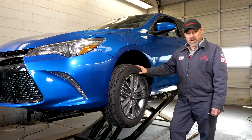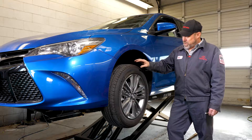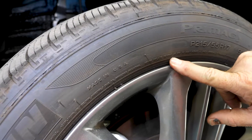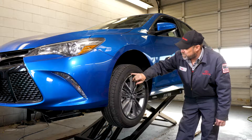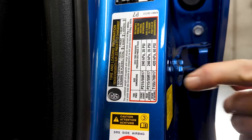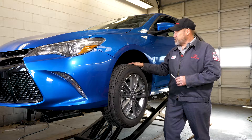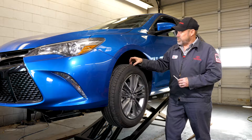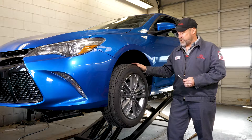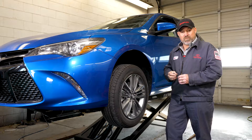The fourth thing that we should check is your tire condition. You want to check your tire tread and your tire pressure. If you look on the side of the tire, it'll tell you the maximum this tire should be inflated to — in this case 40 PSI. But the best place to check that is in your driver's door post, where there'll be a sticker from the manufacturer stating the safe level. When looking at your tire tread, check for excessive wear on the inner or outer edge — if both have it, that tire has been under-inflated. If the excessive wear is in the center of the tire, then it's over-inflated.